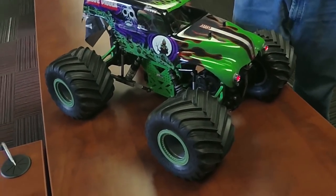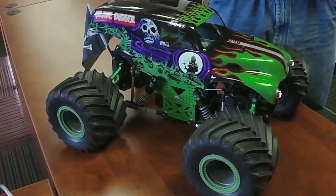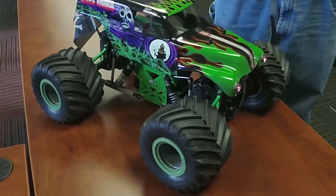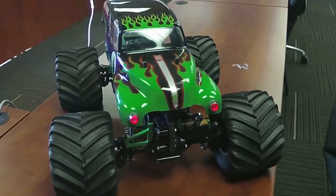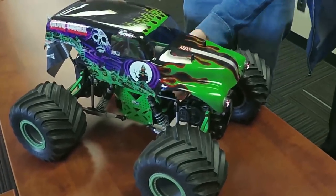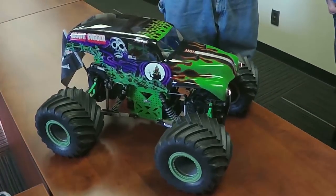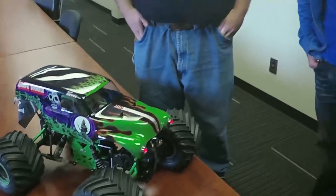This is a brand new piece for Trigger King this year — it's a Chaos Gravedigger. After one freestyle in the summer it's not gonna look as pretty as it does right now. It's a Chaos chassis, the first Gravedigger I've had since my very first one that has a green chassis. The old Diablo had that carbon fiber plate. I had to find a nice paint so I went with Krylon neon green — four or five coats to get that pop of green. I primered it, put the paint on, and then one coat of clear. If you guys are going to be painting your chassis, spend the extra money on clear coat — when you beat these things up, it's a real pain to tear them down and repaint them, and it really helps the chassis stay alive.